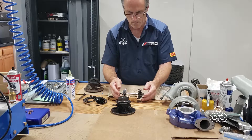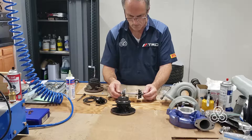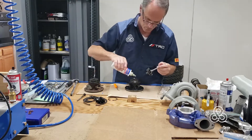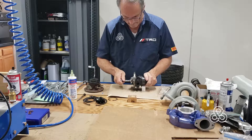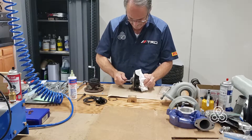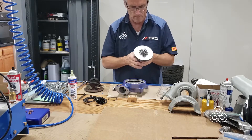As I mentioned, I replaced the ceramic blades with Inconel turbine blades. I have a small block made with a couple of razor blades set up perfectly level — this is the process of taking the balanced Inconel turbine blades and the factory-balanced compressor blades and mounting them on the balancing rack until they're balanced in tandem. Once I know where the blades are positioned, apply some assembly lube, put the turbine blades through the bearing housing, then put the compressor blades on and tighten them up. Always remember: the nut on the compressor housing is a left-hand or reverse thread so it won't loosen during spin-up.